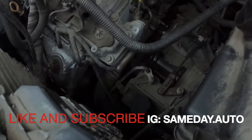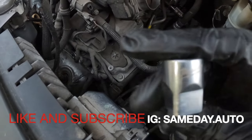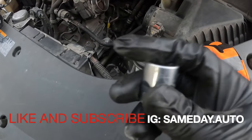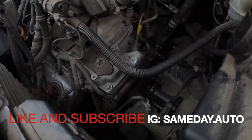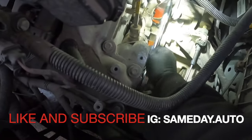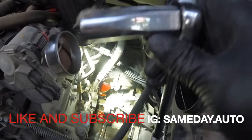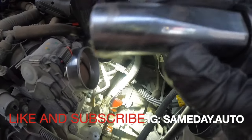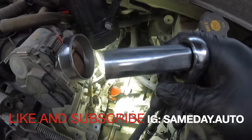You can't snake it, so let's get that bolt out of there. Okay people, that bolt back there — I see it — it's a 15mm. I recommend these Milwaukee sockets with that square end, gives you some room — kind of a shallow head. Actually, take that back — you need a deep 15mm. This is also a Milwaukee socket, but you need the deep so you can get that bolt in and get it out. The short won't work. Put this deep 15mm on there and you can get that bolt out down there.